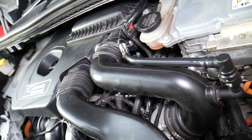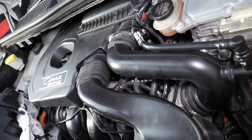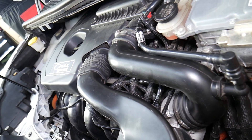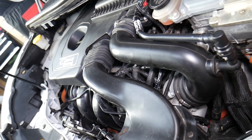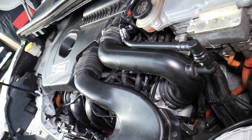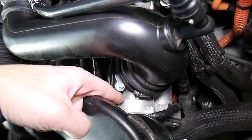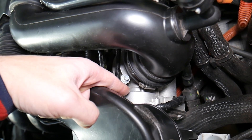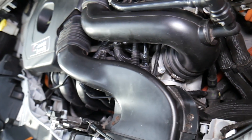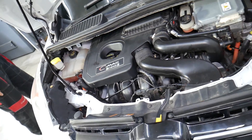Vacuum leaks are quite common. We have a dedicated video explaining how to fix vacuum leaks on the Ford C-Max, Ford Fusion, and Lincoln MKZ — it covers almost every possible place where a vacuum leak can develop. Other things to consider: a malfunctioning or dirty throttle body. The throttle body is responsible for RPMs and idle. We also have a video on the channel showing you how to clean the throttle body step by step.